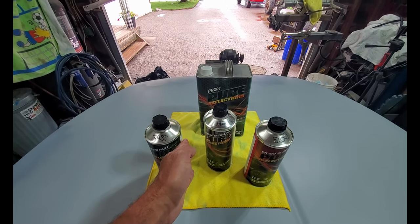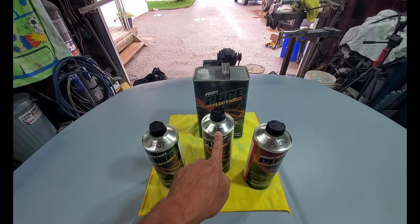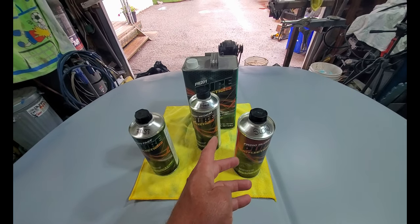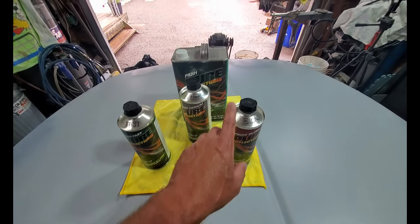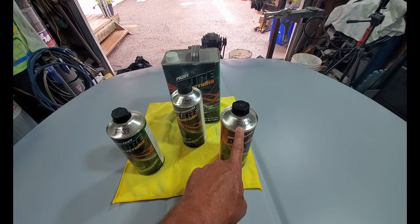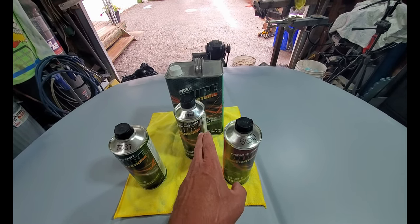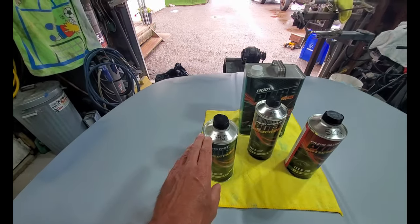The broader window I feel is more like 60-65 up to around 80 for a medium activator. Yesterday it was 95 degrees Fahrenheit. On a day like that, if I was painting this hood and throwing the clear on it, slow would be the way to go — because it's exactly what it says: it's going to slow down that reaction and give the clear coat time to flow out before it skins over and goes hard.